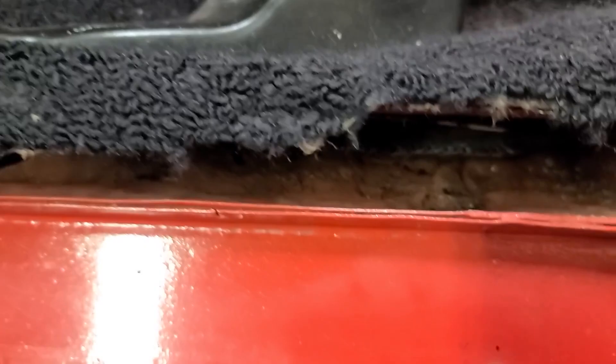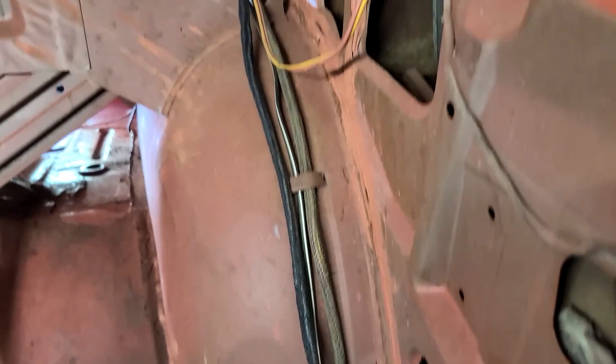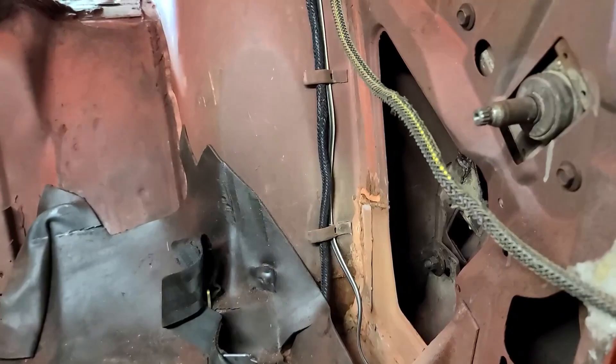Okay, you can see the cable is in the trough. Get the carpet out of the way — it's there, it's going out, and then it is going to go in the hole. So I just need to undo those little wire clips, and then the old cable will be ready to pull out of the hole, and then it'll be isolated to the trunk, and then we'll do the connection for the dome light.